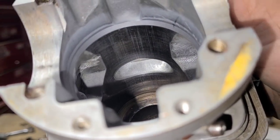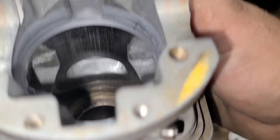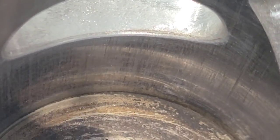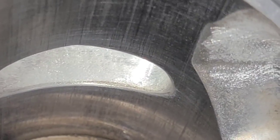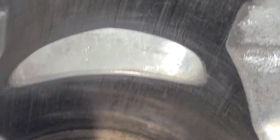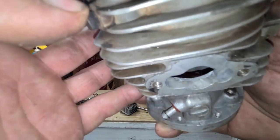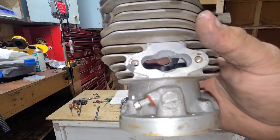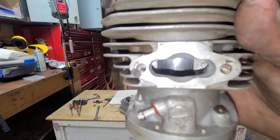A lot of you guys are porting and tearing up your pistons. See the chamfer here? That small little ledge is my chamfer — it eases the rings in and out of the exhaust port and gives you something nice to smooth. Here's the intake; we didn't do much to it, it's a little roughed up but it'll do. These Macs have really wide exhaust and intake ports — be aware of that, it changes flow and changes what you should do to it.